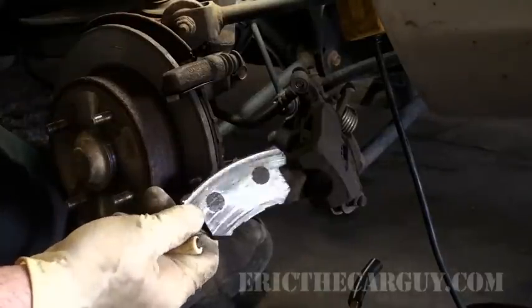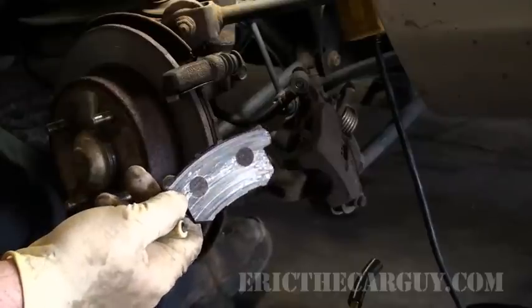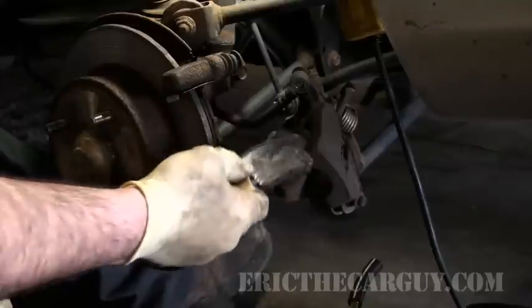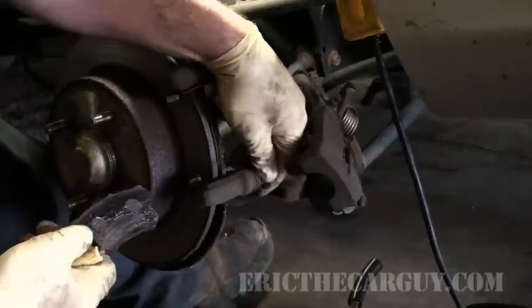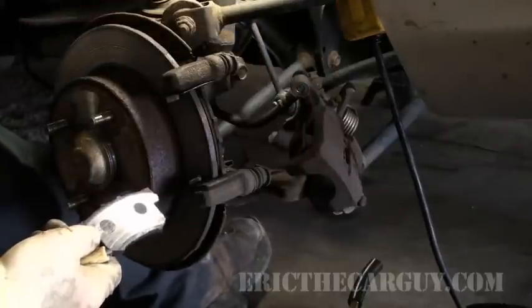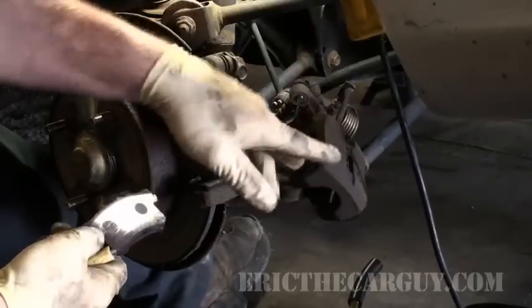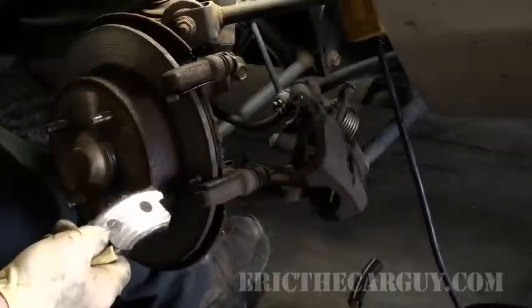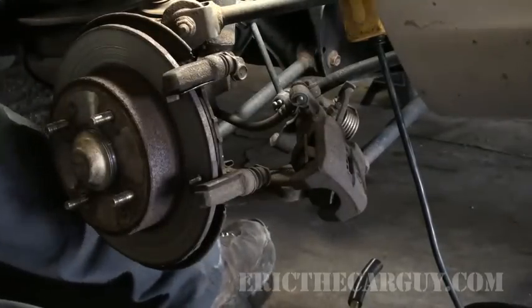Something you never like to see on your brake pads — not good. If you see something like this and you've got one side that's worn down this much and the other side looks normal, you may have a problem with that caliper, either with the slide pins — make sure they move like they should — or it could possibly be the caliper itself. If the boot or the piston does not return back into its bore, it can possibly cause that same problem. Sticking caliper, and if that's the case you will need to replace it.